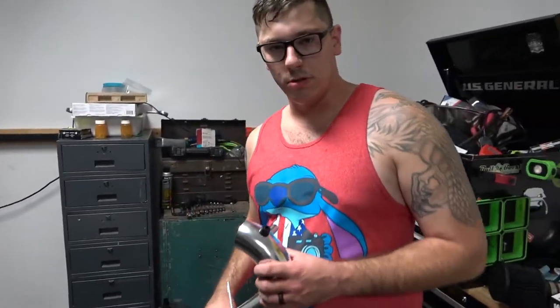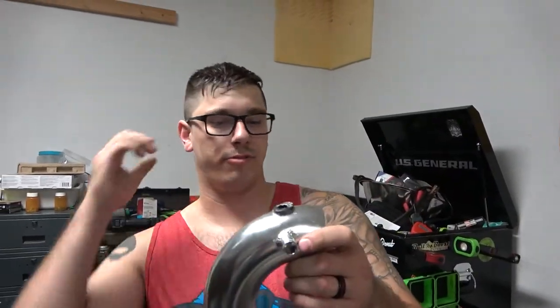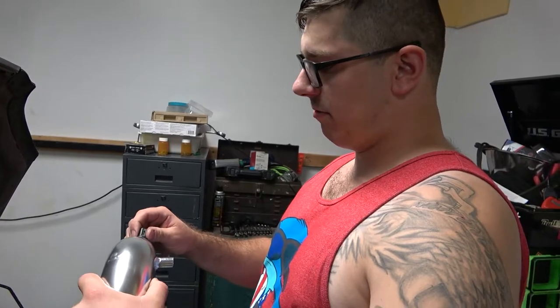This one goes on first, but before you do that, you need to take your mass airflow sensor off of whatever old intake you had. This little guy — it's not going to have the gray stuff on there; that was something I did to seal it in my last intake. So this is your old seal that goes around your mass airflow sensor, and this is the one that comes with the new one. This is too tall — your sensor is not going to protrude far enough into the pipe to sense what it needs to. Reusing your old seal from your previous intake or air box should be fine, but it might not hurt to put some sealant around it, because on mine at least the fitment was a little bit loose and I don't want any leaks. Now I'm going to get him in there. There he is, baby. He's vibing.